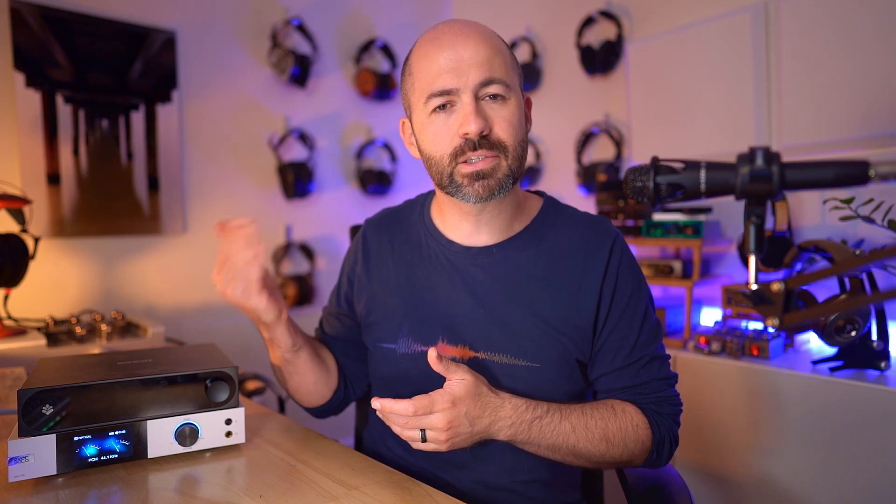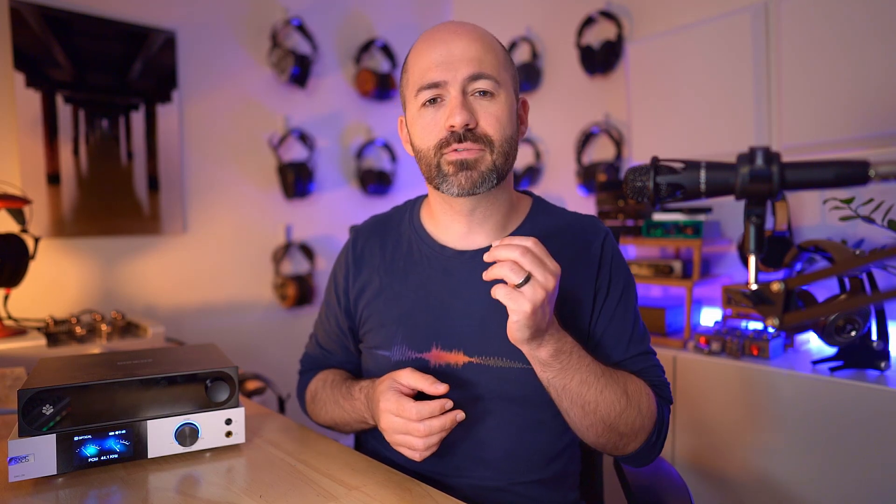As an all-in-one where power isn't a concern, I'd probably lean towards the Z6, but if you're looking at it predominantly as a DAC with occasional headphone use, the M500 could be the choice - though I kept coming back to the Z6 for its interface and look, not just the VU meters. One quality-of-life thing I really love about the Z6 is auto-switching connections: when you plug in headphones it automatically switches off your monitors. With the M500 you have to go into the menu and manually select RCA, XLR, or headphone output. The Z6 lets you preset RCA or XLR and then automatically switches when you plug in headphones. With the M500, because they've included a 4.4mm Pentacon connector - which isn't actually a balanced output in this case anyway - you lose the automatic switching of preamp outputs, which is a real shame.